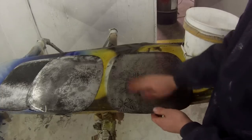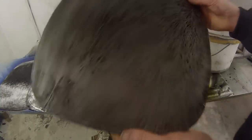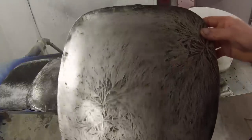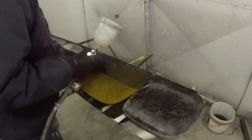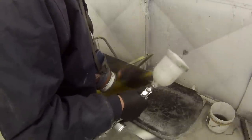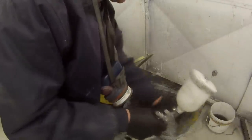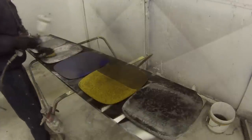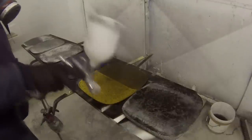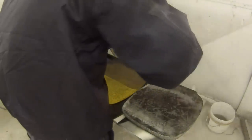Same thing with those aluminium test panels — basically the base coat is not strong enough to stick to the aluminium. But I came up with an idea: if you really wanted to go over bare aluminium with Mutant Crystals, DNA do have a product called KeyClear, which I believe is similar to an epoxy clear, so it's going to really bite into the alloys. You'd put that clear down first, seal it, then put your Mutant Crystals over the top of that clear, spray your black on, remove it, re-clear it, and you'd have a Mutant Crystal over alloy finish.